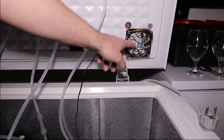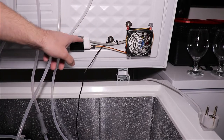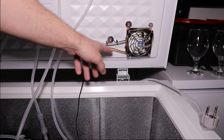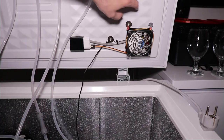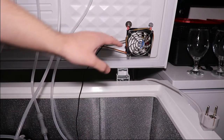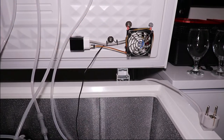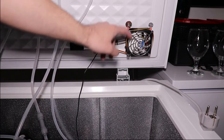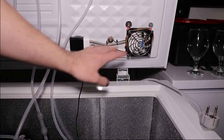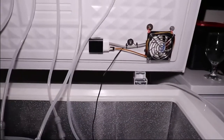This fan is actually connected to this power brick from an Amazon Kindle. You have 220V power coming in, it's transformed into 5 volts, and this 12 volt fan is powered by 5 volts. Why? It's to cool down the temperature controller. Because of the huge amount of insulation these freezers have, that temperature controller was not getting properly cooled, and I may have already burned two of them because of this. I'm running the 12 volt fan at 5 volts because at 12 volts it's too loud and I don't want to hear it from my couch. Now it's very quiet. As a bonus I still have a USB port here, so I can hook up a USB flashlight and have light in the freezer if I open it at night.